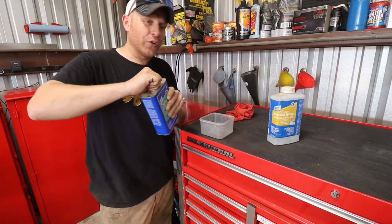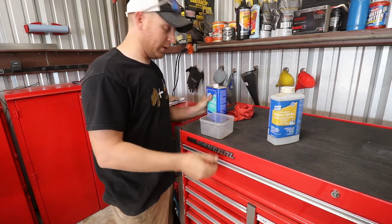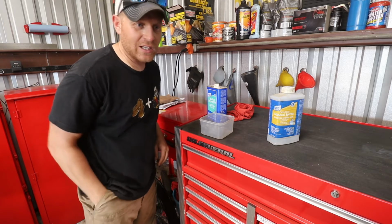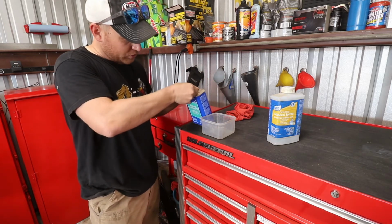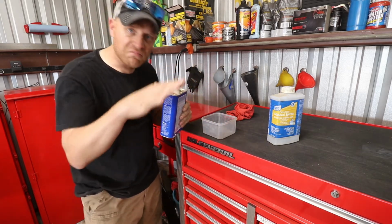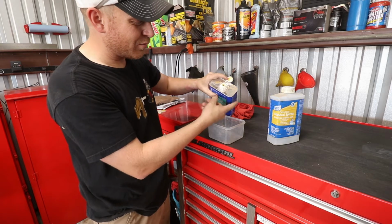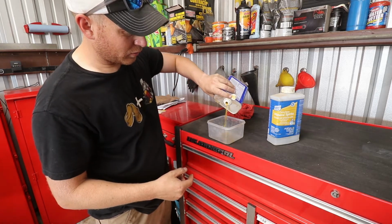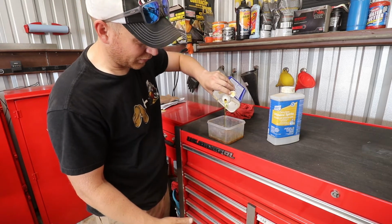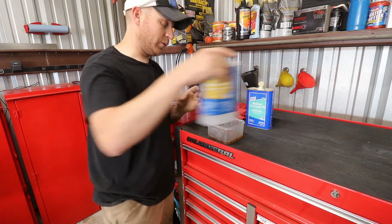if it's an oil and you just pour it on and smear it around, it's probably going to leave streaks, it's going to leave a bunch of stuff like that. That's not what you want. What you want is some way of keeping it smooth as you go through this process, which is one thing that's really good about the mineral spirits: it makes it a little bit more of a liquid. Usually what I do is about a 50-50. You can do more oil, less oil, but it's kind of like thin motor oil. That's about the consistency.